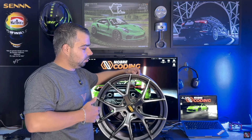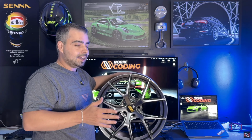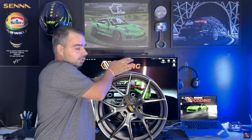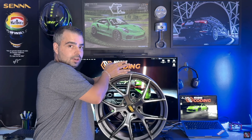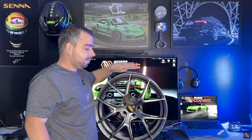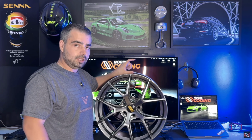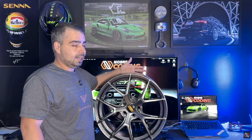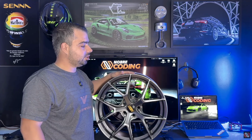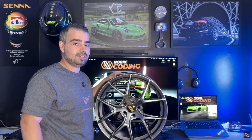So what I recommend for a set of 18 wheels with a width of 8.5 is a tire around 235/40/18. So the tire stays very straight here, it's perfect. When you look at it from the side, it looks like the tire is right with the wheel assembly. If you put a 225, it will be too bent towards the inside, so it won't look so good, okay? And if you put a 45, it will have that balloon tire, so it won't look good either, okay? For people who like to speed up, I would put a tire up to a profile of 40, 35 at most. I wouldn't put it below 35 because then it will be that tiny tire that will rub the wheel on the ground. It will cause a lot of problems when accelerating, it's not so safe anymore, okay?